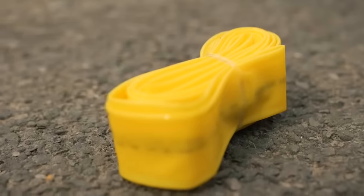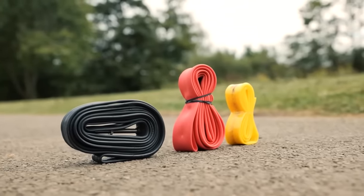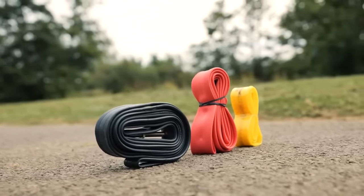There's a chance it could just puncture as it pops trying to fill the inside of the tire. Realistically, you need to carry an inner tube designed for the wheel size and tire width you're using. This is one of the advantages of TPU inner tubes — they fold up way more compact, even ones designed for super wide tires. They're expensive, but the rolling resistance is really good, they're lighter, and something a lot of people don't realize: you can repair and patch them with special kits.